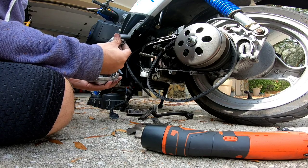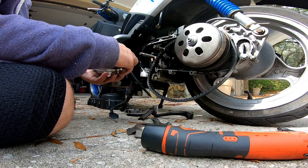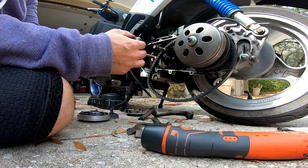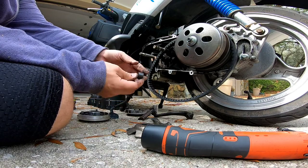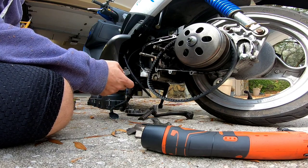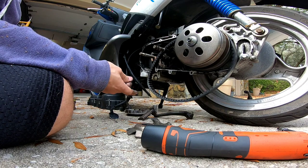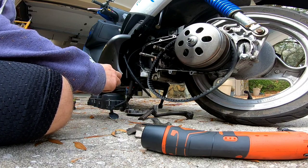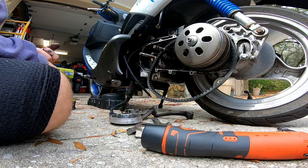Some of these rollers are very bad. That one's not too shabby, but he definitely has a good amount of flat spots. These rollers are getting stuck sometimes, and when they get stuck they cause serious flat spots. They're also covered in belt material. I think what I'm going to do, since they don't look completely destroyed, is just clean all this out and put it back together. Let me get some cleaning solution, pull these rollers, and give them a good cleaning before slapping it back together.